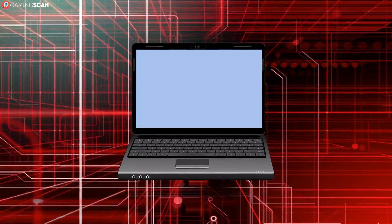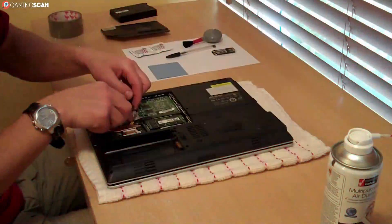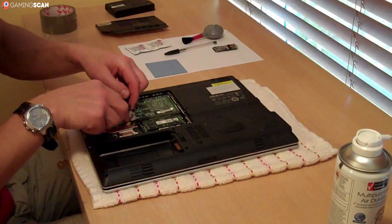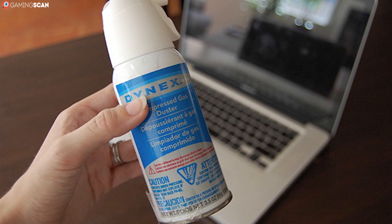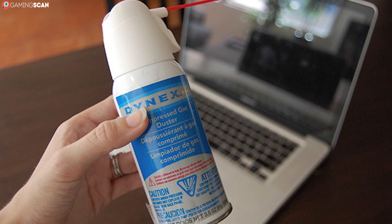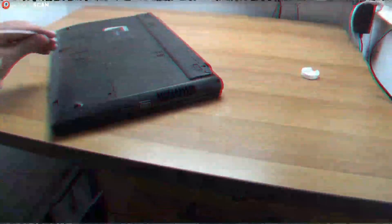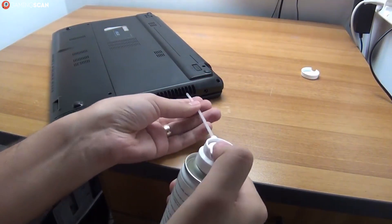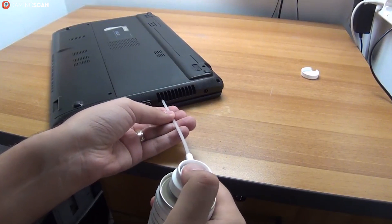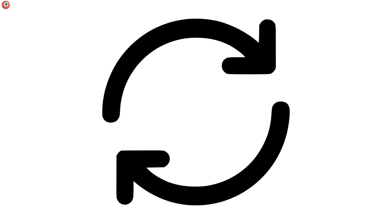Before you start, make sure you turn off your laptop and give it ample time to cool down. Once it's cool, all you need to do is hold it on its side so as to expose the intake fan grills on the bottom. Now bring the can close to the grill and spray, but make sure that you're holding the can upright, because otherwise some of the liquid air might escape and this can cause damage to the hardware. Move and tilt the laptop around to clean the intake from every angle. Do this until you no longer see any dust coming out, then repeat the process for each grill.